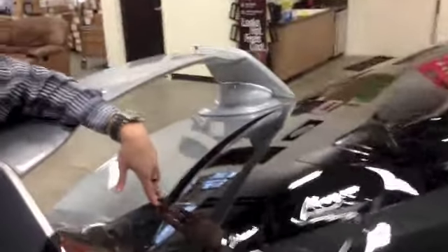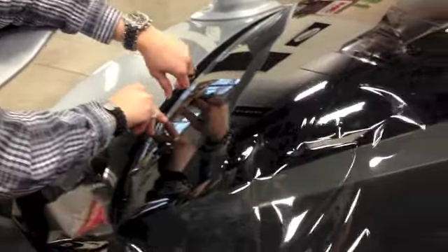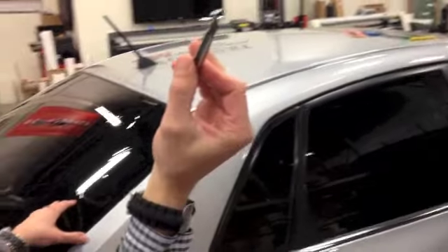Even doing a rough cut or anything, this acts pretty much like a wallpaper seam buster, but I can actually get it going underneath the film with a plastic ride along the border, and that way my blade never actually even touches the glass. You can do it for your rough cut and also your final cut.